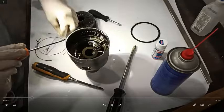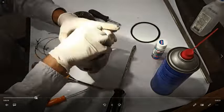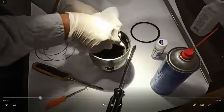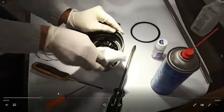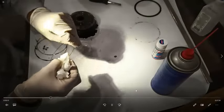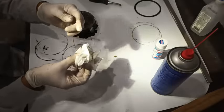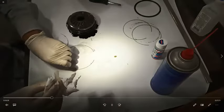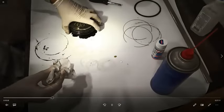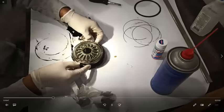Remove all the wires — you need 12 wires — and I believe there are 24 plates. I just wiped everything out with a paper towel and cleaned it; no water this time. You can see the fluid broke down prematurely — there's an oily puddle. The fluid broke down really quickly because the weight was so low. The coupler was just free-turning constantly and wasn't really transferring torque to the rear differential and rear wheels very well.